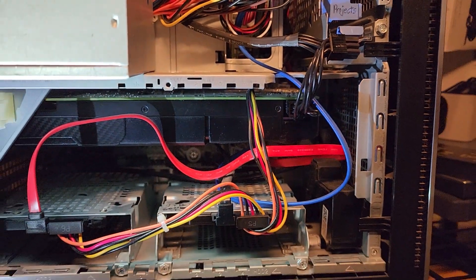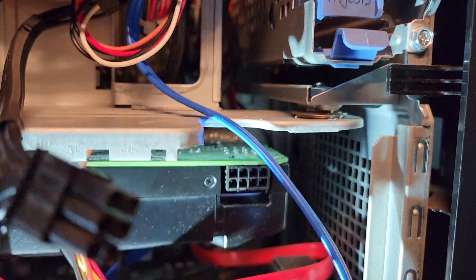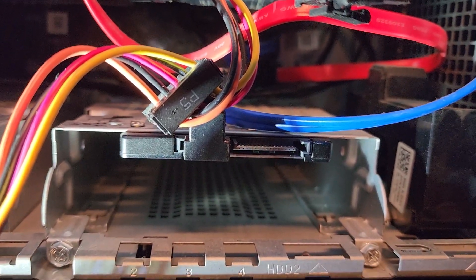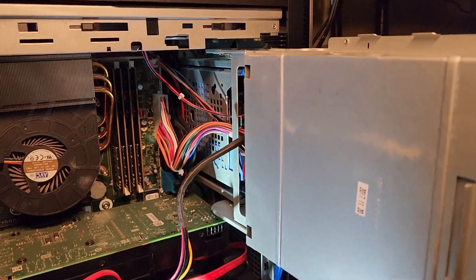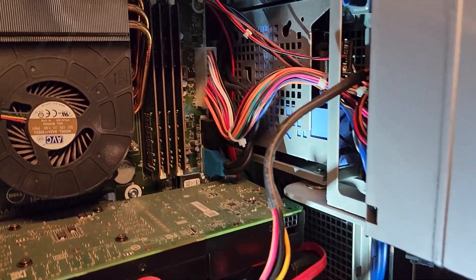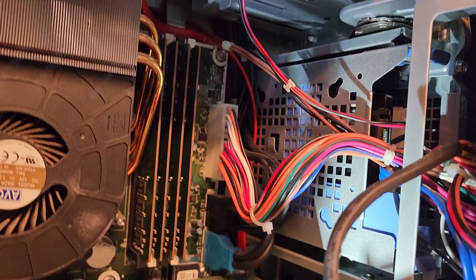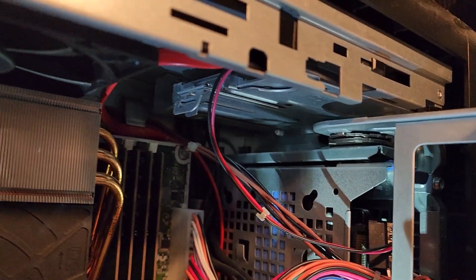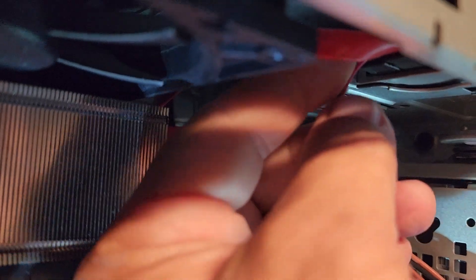We're going to unplug that. I'm showing you everything that's plugged in here — and showing myself too, because if I lose my way I'm going to consult my own video. The new power supply is modular. I pulled the power off of each of these SSDs. Because I do a lot of video editing I need SSDs. There's your main power plug right there on the motherboard — I'm going to pull that out. There's a little clip on the right side, and look at this brown and black wire going to the back — it's another plug that powers your motherboard.